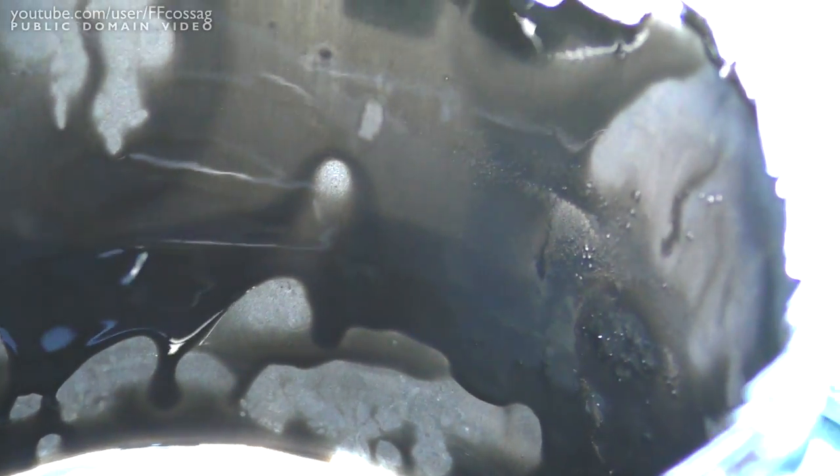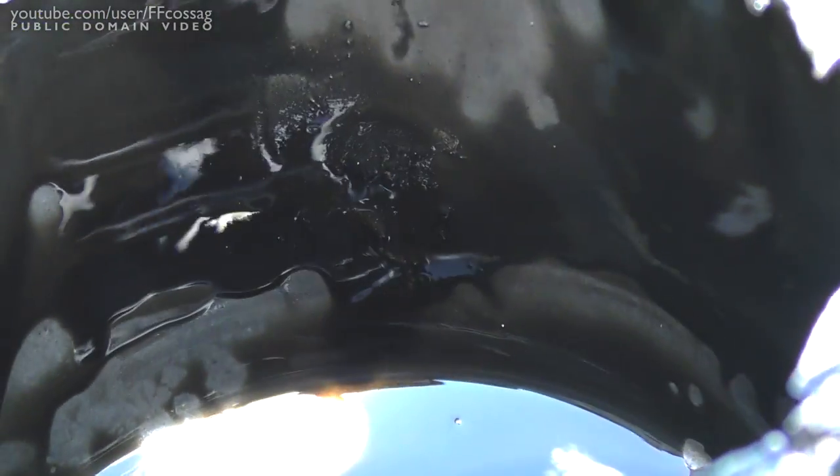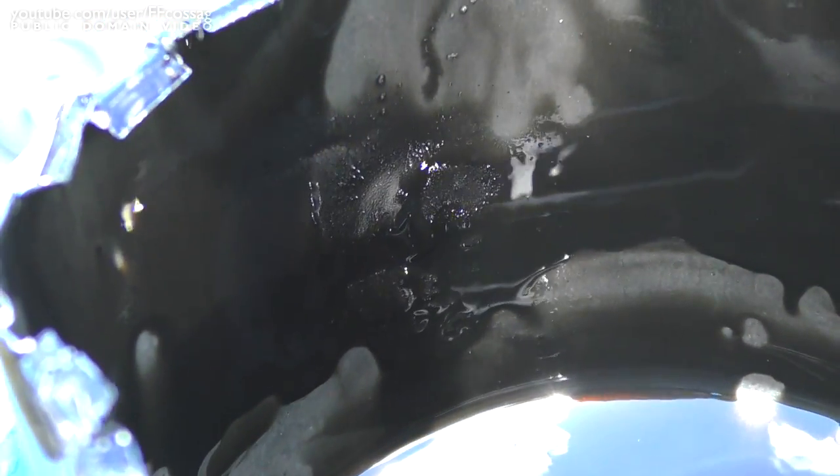These magnets have moved. Since we've been mounted above, we've got a big collection of metal right there. Some of you are probably screaming that my engine is giving up, since it's full of metal. But this is pretty normal, since this is the pre-filter side. You wouldn't see this in your sump ever. This is the kind of stuff that is supposed to get trapped in your oil filter. If I move a magnet, you can see the slosh of fine metal particles moving about, and all of this would be getting stuck in my oil filter — the actual filter element — if not for magnets.